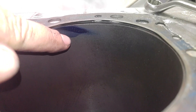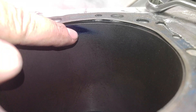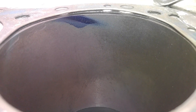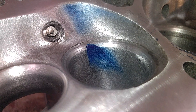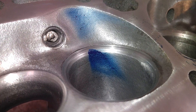I definitely want to get it fixed though. Interesting stuff. As far as I'm concerned, with the back cut it's got a little bit less swirl than without the back cut. I'm liking the back cut a little bit better — you get a little more flow. It doesn't quite look as good on the chamber, but I'm still going to do a little bit of work on the short side radius on these.